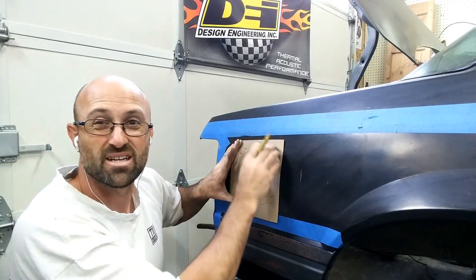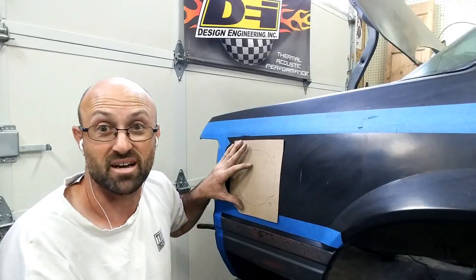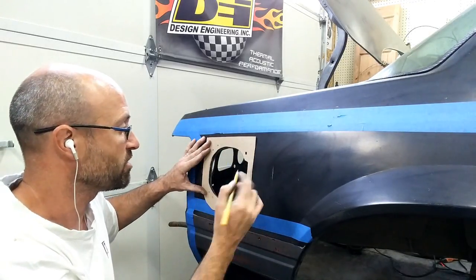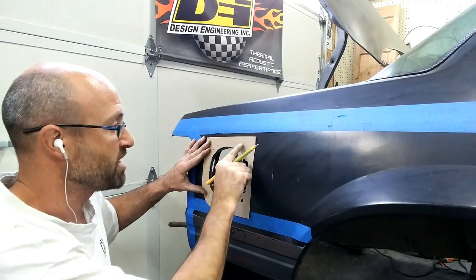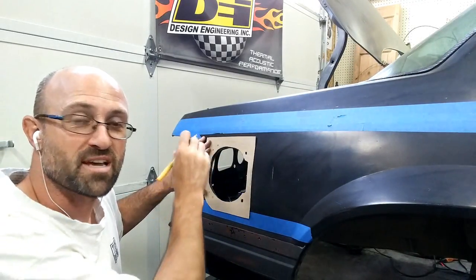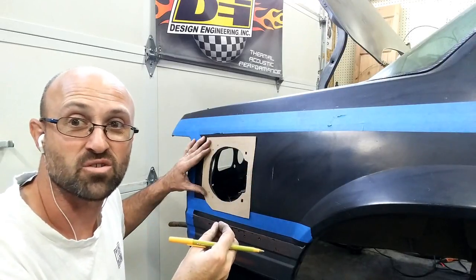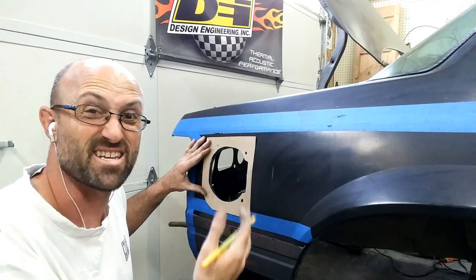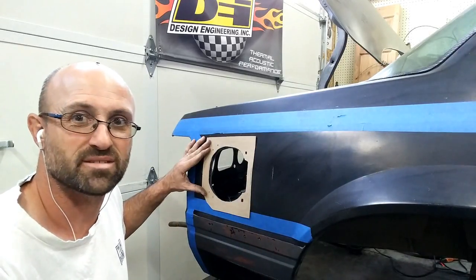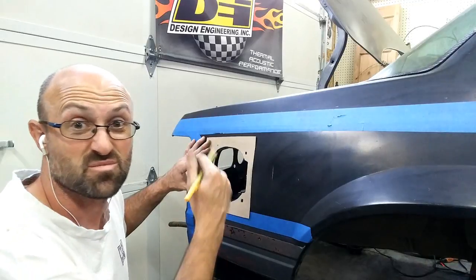Basically I'm going to have a ring showing me the way that I can then take over to the flare and use that ring inside there to define where everything needs to be cut out. So now with the opening cut out, this is obviously the fuel door - once it flips open you'll have this opening. I'm just going to use a pen, put pressure on it, and give me a rough estimate. Once I get a line all the way around where I think it is, I'll use some scissors and trim along that edge, then fine-tune it. Remember to take your time and sneak up on it versus just going right at it, because if you overcut it you're going to be disappointed. Sneak up on it, give yourself a line all the way around, then use some scissors.